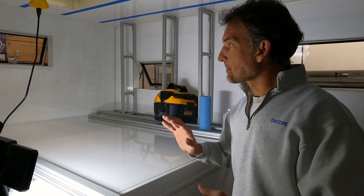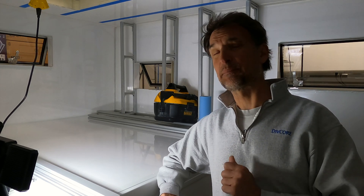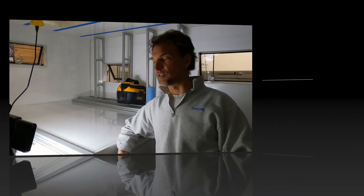Here's what I've got to do. I've got to glue in these mounts that will support the dinette table tracks and also the bed tracks. There are two key things: they have to be glued exactly in the right place, literally by the millimeter, and be perfectly parallel and straight down the center of the camper — within a millimeter in every one of those dimensions.